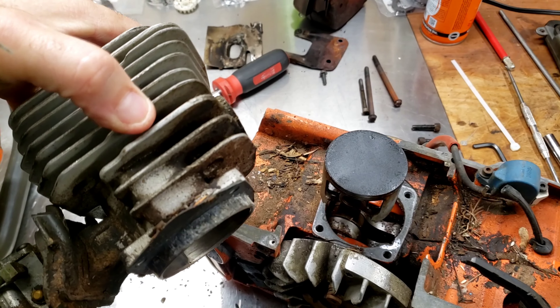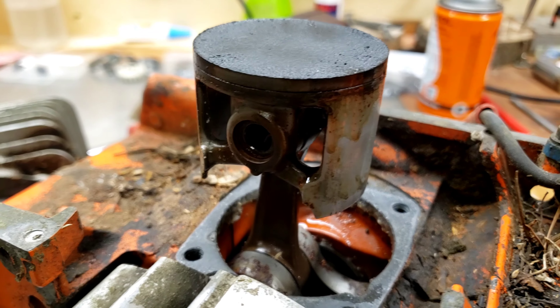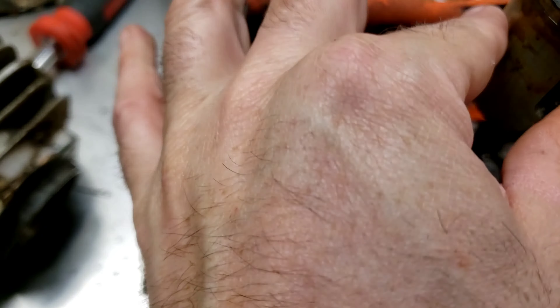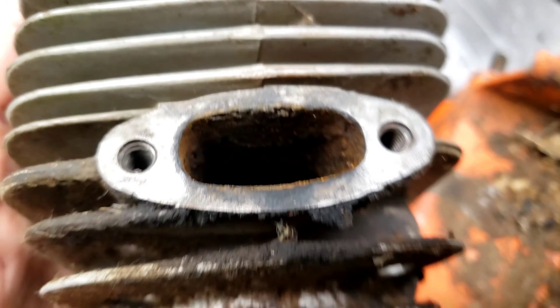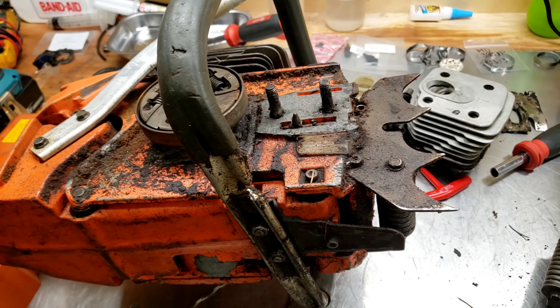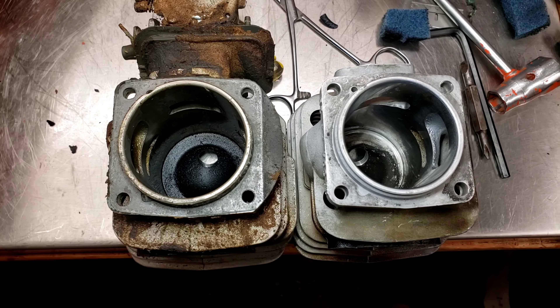I don't know if I trust that piston. I think it would actually clean up — I might just get a new ring for it and rehab that piston so they're a matching set and go from there. There's a very slight amount I can barely feel — guessing it's carbon from the exhaust port. Might just clean this up and run it the way it is for now while we gather parts, but we'll be throwing that top end on it to make it a true 288.